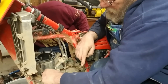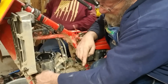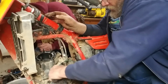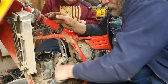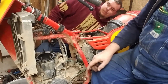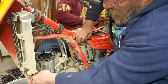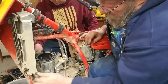All two strokes, chainsaws, dirt bikes, have all the same principles. You'd be surprised how many of them have the same numbers, honestly. This bike's got V-Force reeds in it. We'll show you all that. They're a good reed, much like the old Boyesens, but V-Force does a lot with the carbon fiber reeds. That's why I like Bucket's P38, stuff like that. These bikes are what gives us the real deal. We're not going to mess around with the old style reeds and leave them alone on the reed saws. We're going to do bike things to them, quite honestly.